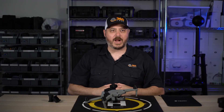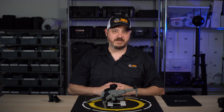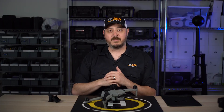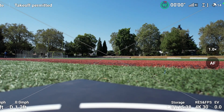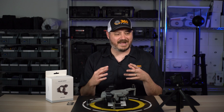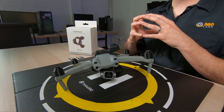A big problem with the camera is the GPS signal. On Insta360's website their advertising specifically tells you that the camera will not impede the drone's GPS signal, but for many people, myself included, this is not true at all. In an open area we commonly get somewhere between 18 and 25 satellites, but with the camera on and recording we'll get 12 if we're lucky. It hovers on that line of the minimum satellites needed to stay positioned in GPS, understand where it is, and set its home point.